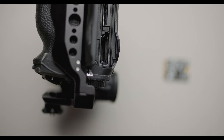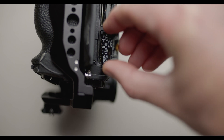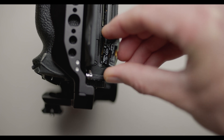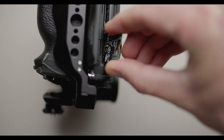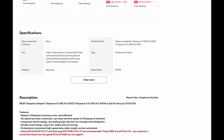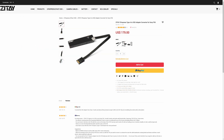If you're wondering about cheap options for Type A CFexpress cards, unfortunately those cards are smaller than the M.2 form factor, so it's not possible to get a DIY solution like you can for Type B cards. I have seen some card adapters that adapt to an external full-size NVMe drive, but these are expensive and reviews of them don't seem that great.